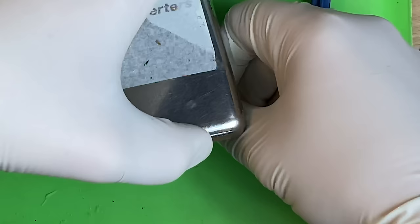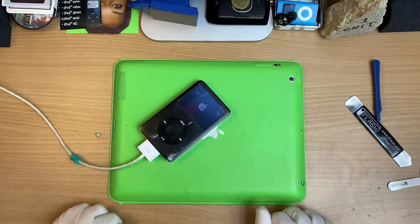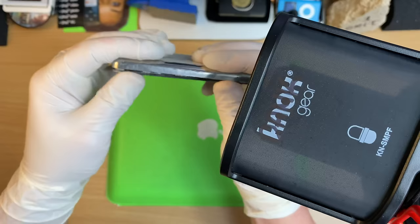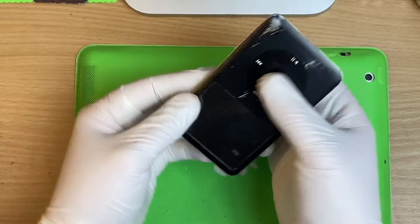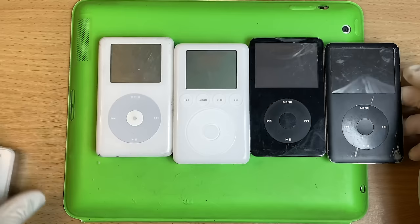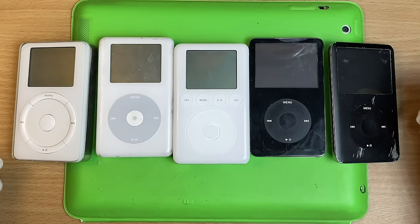Let's see if she even boots — where's that Firewire? There we go — nice! I'm calling that a win. iFlash actually recommends that you bend the panels back into shape because of the aluminium warping — just lean it on a table and give it a bit of pressure. We had this completely disassembled and reassembled. While this video is a bit dirty and slapped together, I just wanted to be a first point of contact to give you the confidence to jump in there and do this. These guys are far hardier than they look.